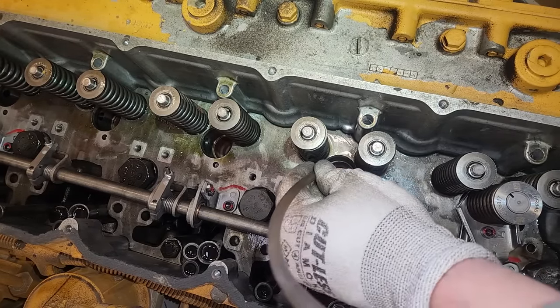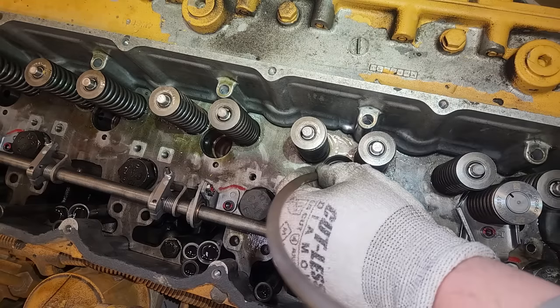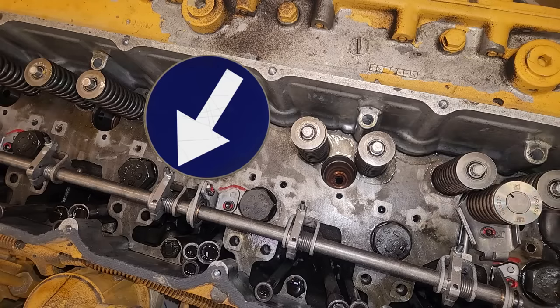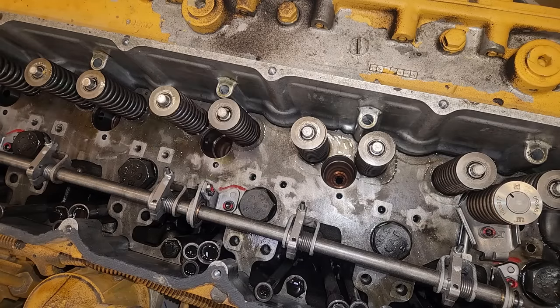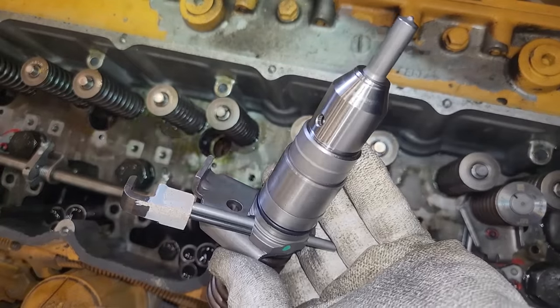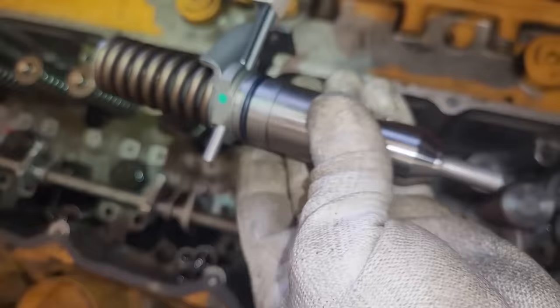And we're going to be doing the rest of the injector installation here. Now you can see what looks to be like little rocker arms there next to the push rods. That is your rack if you're not familiar with it. And that's what we'll be adjusting in the next video, and how to properly do that is extremely difficult if you haven't done it before, and it's quite difficult if you don't have the right tooling.